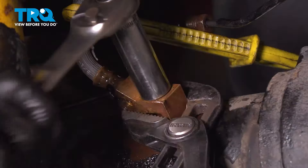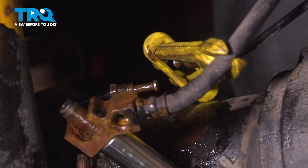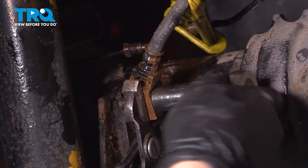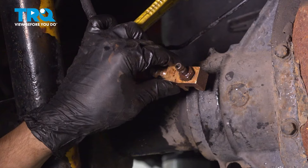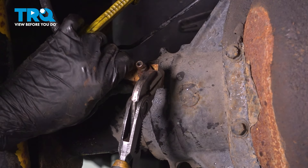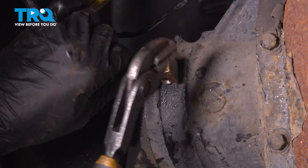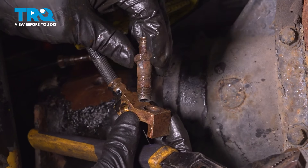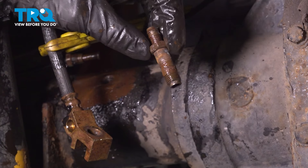I'm going to hold this with pliers and remove it. On the back side, you'll see that there isn't anything holding it on, but it's just stuck because it's corroded in there. So I'm going to get my socket off of here — we will have to reuse this, so I'll have to take it off the brake hose. I'm going to put the threads on the differential side like this and just tap the brake hose. This will poke the breather bolt through. That's why this gets stuck. I'll have to clean this up on the wire wheel. It is reusable. A lot of times these will rot out completely. This one's still fine, just a little rusty, so I'll clean it up and install it in the new one.